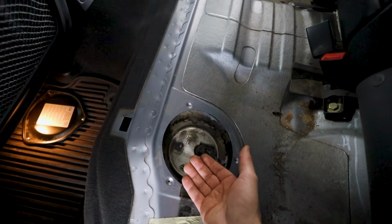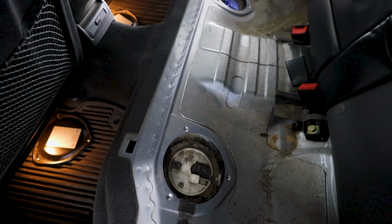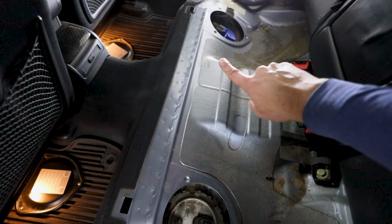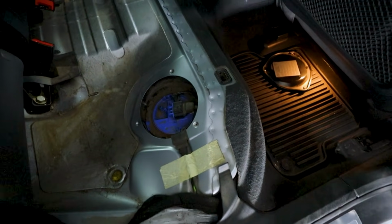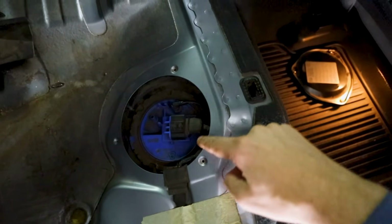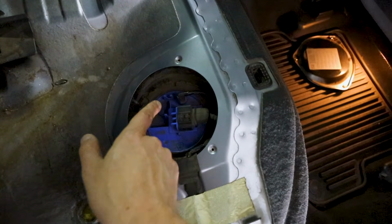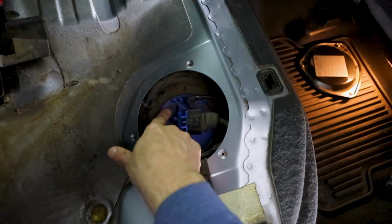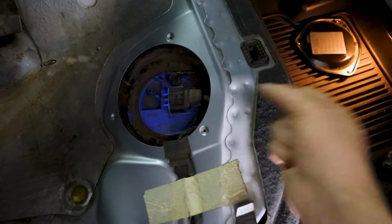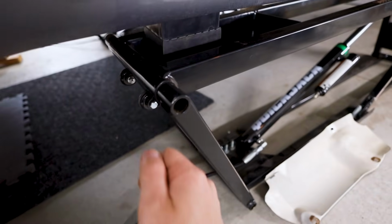So really your first effort, if you're in my position, is that you have to take the fuel lines and kind of like pull them up. You'll hear them disengage. It'll be a bit of a pop and you'll know that it's free because you can wiggle it around and get some movement heading that way. Otherwise, if you're working on this side of the car, the lines don't have those little grooves in the tank that they're connected to. There's actually just a little piece of tape that wraps around the fuel tank itself, sort of in this area. So if you're trying to relieve the vent line that comes into here or the line that sends fuel out of the pump and down into the filter, just know that you're gonna have to loosen up that tape to pull those lines out. Otherwise, it's a joke. It's a straight shot right out the bottom. You just loosen them up on top and then pull them out right here.